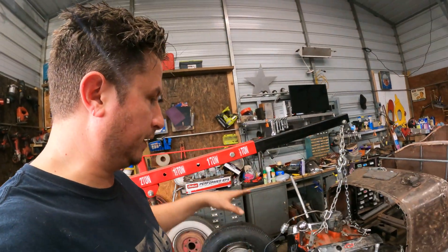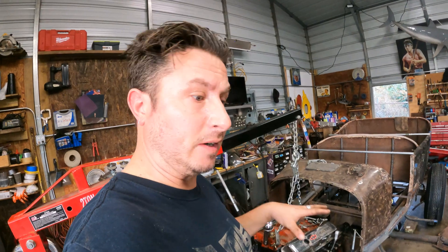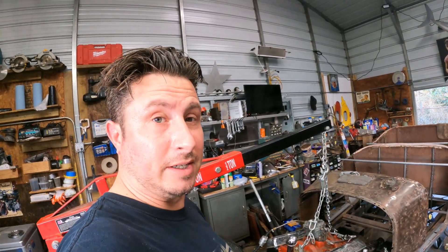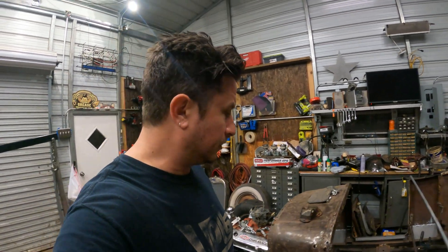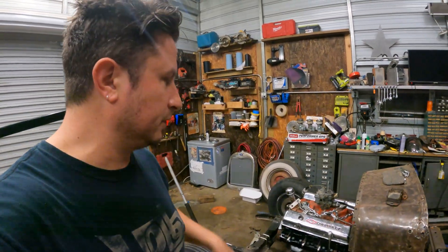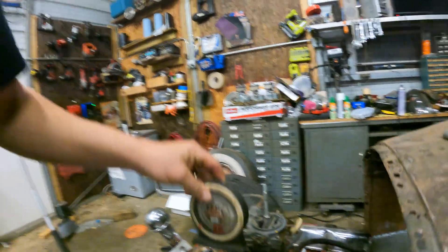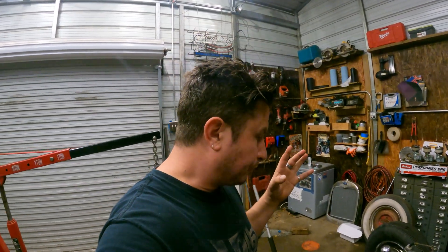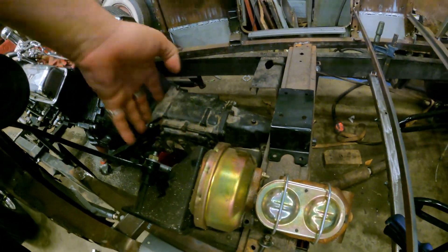I'm going to pull the chains, pull the hoist, lift the back of the transmission up, and lower the front of the car down, because I want to see what the correct angle is once the car is actually on its wheels. Now that this is done, it feels like a much bigger step than I thought it would be. I got the car back on its wheels and used a level to check the air horn — we're at zero degrees, meaning we're level, which means the engine is actually three degrees down, because that's the plane of the intakes. This is huge because now we can fabricate a crossmember for the transmission.